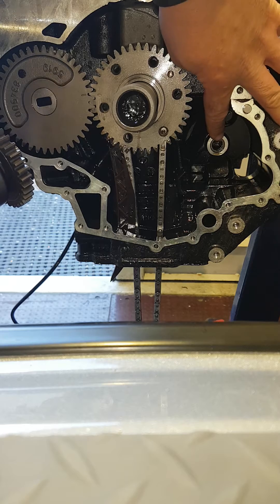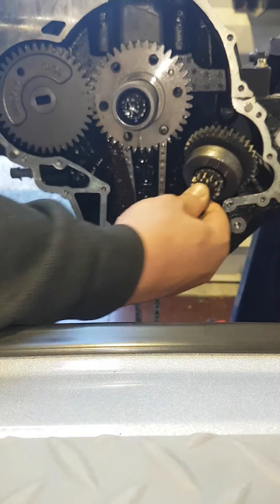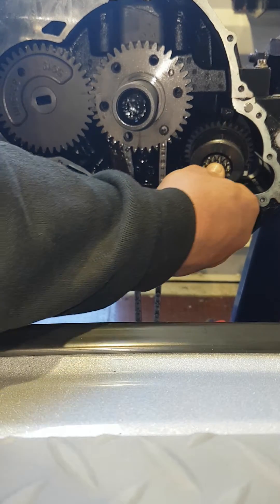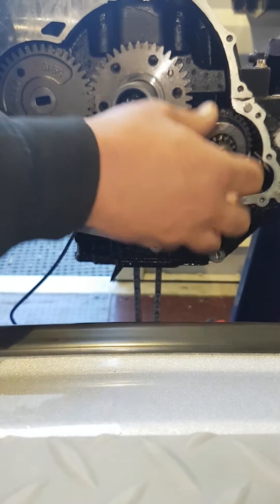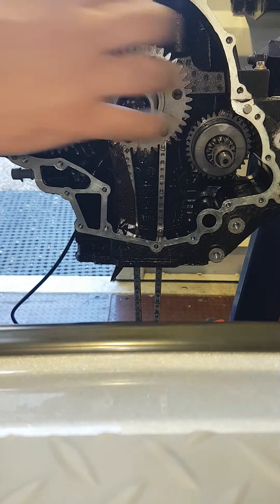The starter Bendix locates in this hole here, the starter motor comes through there for its gear. I've pre-oiled this hole and slot this in. Once the flywheel is installed it's incredibly difficult if not impossible to remove this assembly with the flywheel in place.